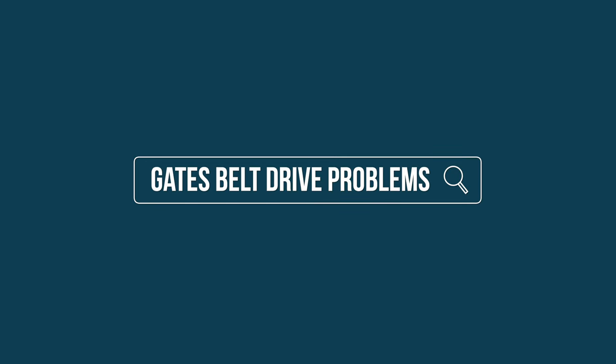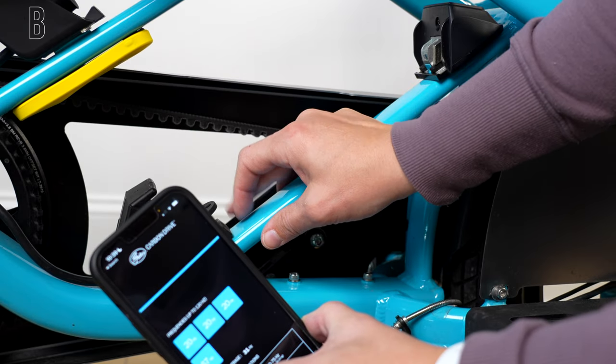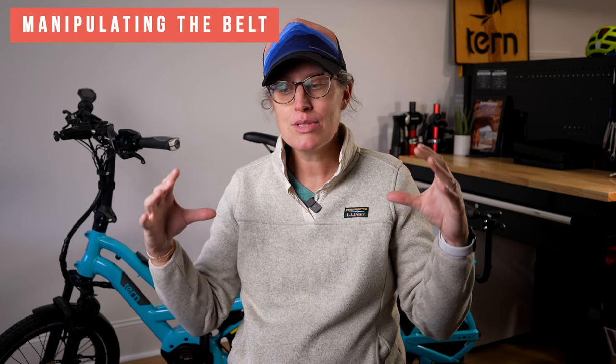Here are the most common problems that I see on Gates Belt Drive. The first is that the belt itself is over or under tensioned — either because the wheel has shifted, whatever applies tension has changed, or it just wasn't set up properly from the start. The second most common problem is when somebody removes the wheel to install a new tube or tire, they don't loosen the tension enough. When they put it back on, they're really manipulating that belt, and the belt is meant to be kept in an oval shape — you don't want to squish it, twist it, or walk it onto the cogs like a chain. This can cause premature failure, and anytime I've seen a belt fail, unless they have 15,000 miles on it, it's because they tried to change a flat and just jammed it all back on.